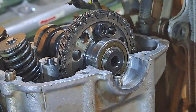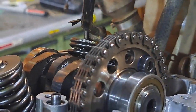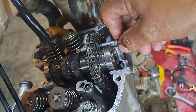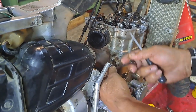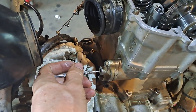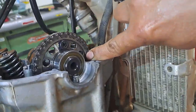Get it finger tight, then rotate around and get to the other side. Put a little bit of blue Loctite on that and tighten finger tight - 25 Newton meters on that allen. We've removed the center bolt from the tensioner and now we're putting in the outside bolts with a new gasket from the Athena kit. Slide a little screwdriver in there, find the notch, and twist it - it comes loose and just spins free. Check the EX mark - we're still at the EX mark. Brilliant!